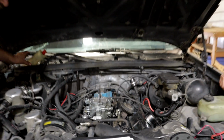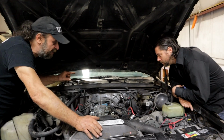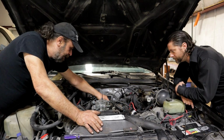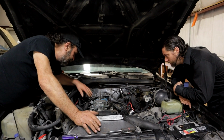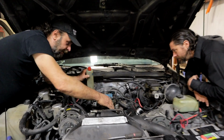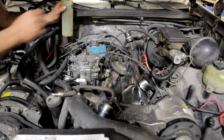We're finally narrowing this down. You've got a vacuum leak at the back of the carburetor. Now, when you first started out, you said that you thought it was leaking from the gasket. Correct, yes. And I think that's what we have here. Because as I was squirting gas around, no reaction here, and as soon as I got to the back corner, yep, that's where she smoothed out.